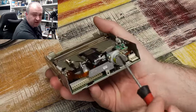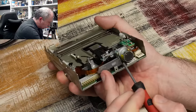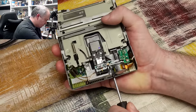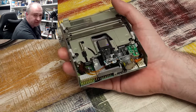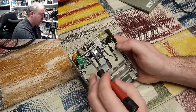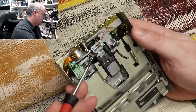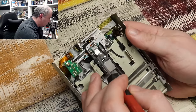The stepper motor itself is also factory set in position — you can see glue around that screw there. That screw doesn't look as if it's been out before, and the glue doesn't look broken. There are various other points around the drive that have evidence of glue — on the stepper motor arm and on the heads themselves. On the top head there are two screws and those screws look like someone's had a go at them with a screwdriver — there's a little bit of damage to the screw head.